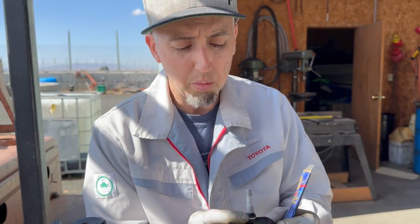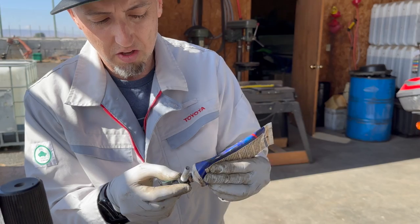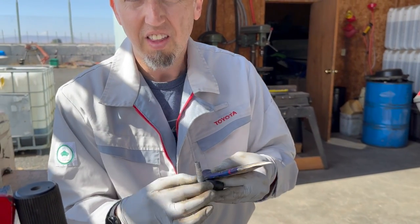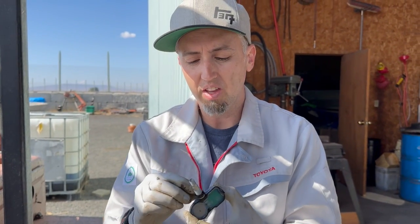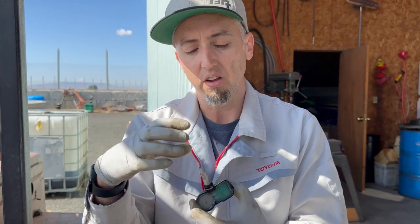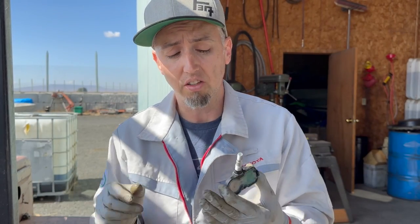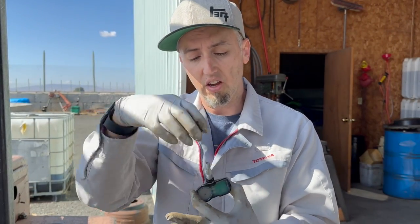Before I put the new sensor in, I get a little bit of lubricating compound and put it right on the rubber part. What that does is when you put it into the hole, it helps keep the seal nice and flat and even so it'll seal properly. That way we don't have any binding when we clamp this down — because if it leaks at the base, your tire's no good and your sensor's going to go off all the time. So I lubricate it, put the seal on, and put it together.